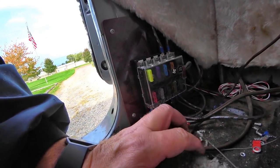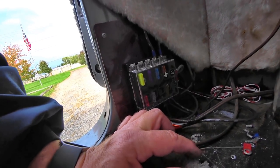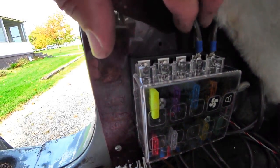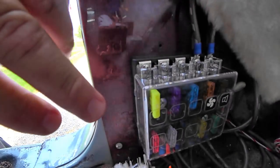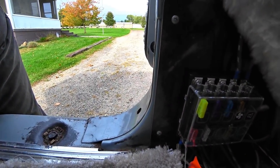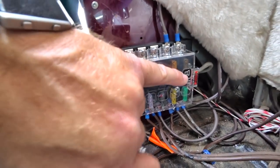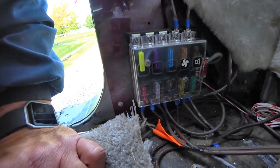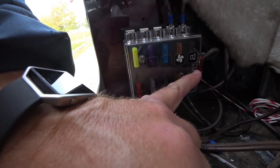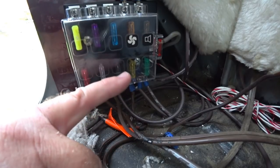We can make it a little bit neater, but most of this is going to be covered up with some sort of carpet or something. The fuse box is finished and everything is connected and tight. We've got it identified on a piece of cardboard, so we'll use that until we have a way to mark it correctly. This is for the fan, this is for the CB and the map light up front, and then we have the house outlet — that's for the 12 volt.